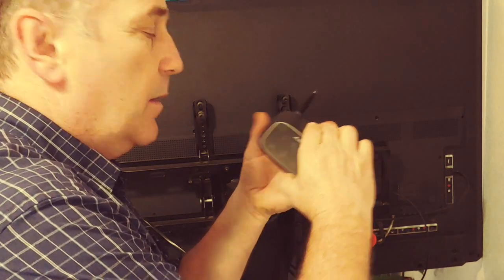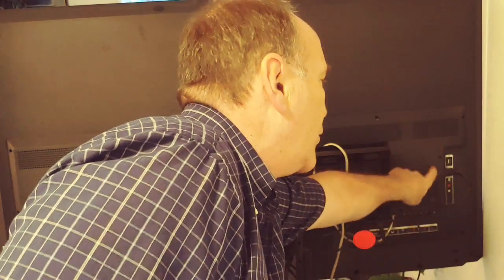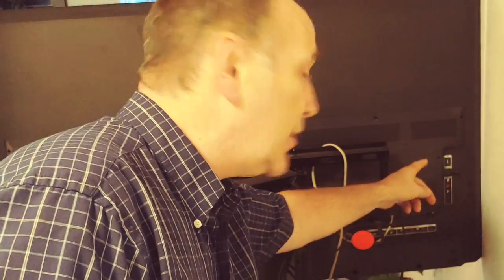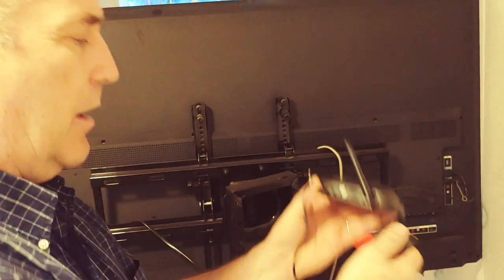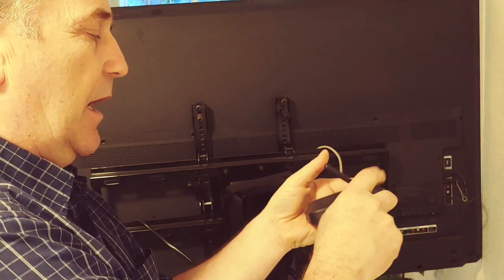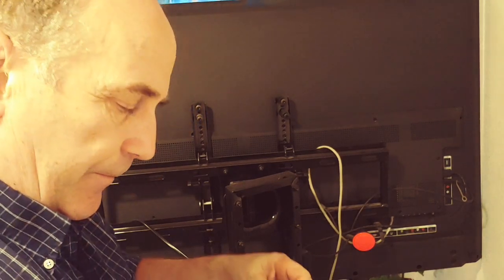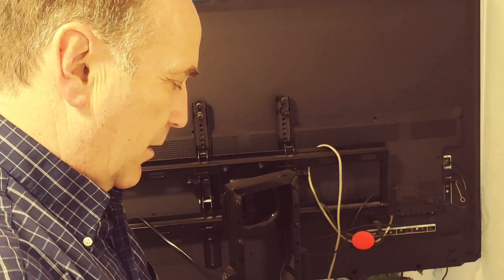I'm ready to hook up the transmitter to the television. After looking at the inputs and outputs, I've got optical as well as RCA. I'm going to use the optical because it's the best sound. I plug the optical cable in — it has a dust cover, so you put the flat side up and push it in. For charging I've got a USB on the transmitter and one on the TV. TV must be on. Power on — 'Bluetooth transmitter mode with active bypass.' It's connected and ready for use. It talks to you and lets you know what you need to do.